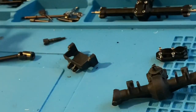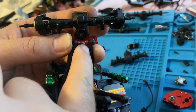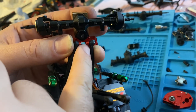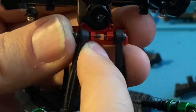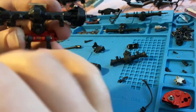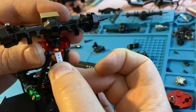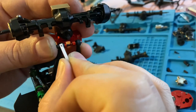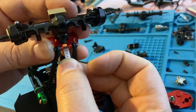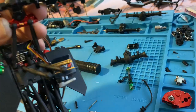That should do. So this side of the servo tray is threaded, this side is not. So this screw can just come in loose and it won't stay. Like I said, you have to put a nut on there, but we're going to go ahead and mount this in here. We'll put our little hole in there and be able to screw into there, and then mount our center limiting strap to that. It'll be pretty good, I think.